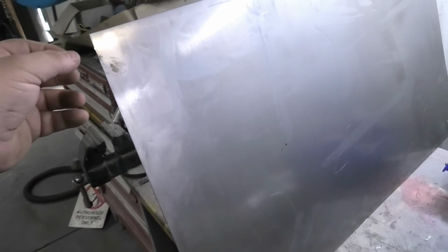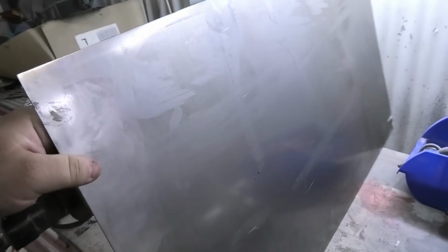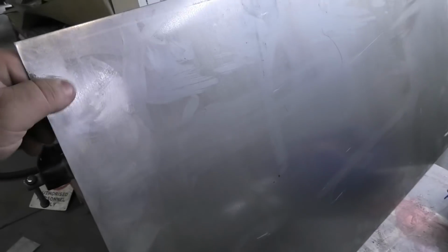I use 1mm non-galvanized mild steel. It's my preferred method. It gives you a bit of wiggle room. A little bit thicker than factory, but not by a lot. Once you start grinding down welds and stuff, it usually gets pretty close to the end result.